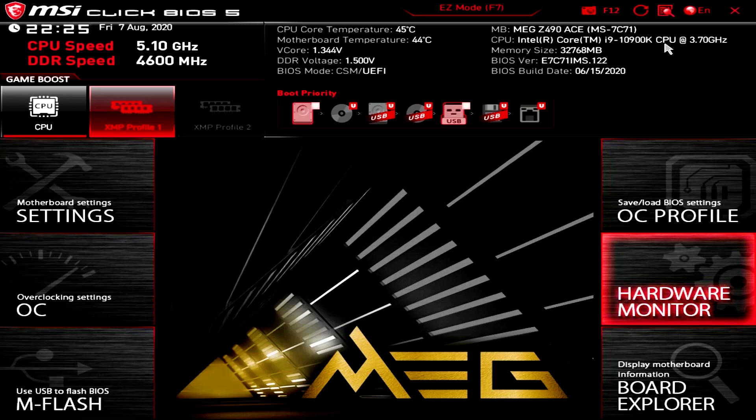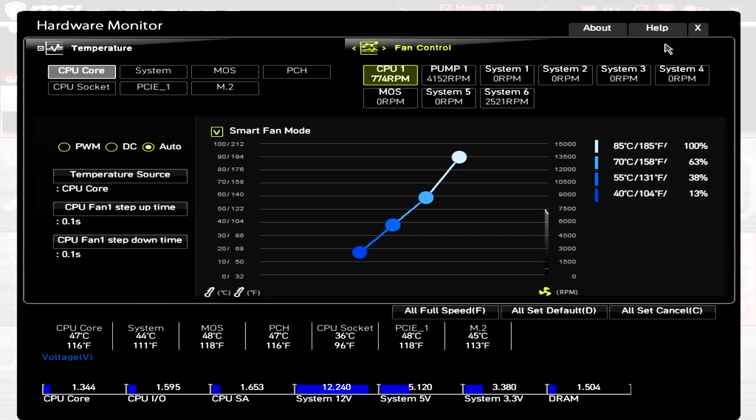Finally, some cooling tips. If you're hitting around 90 degrees, you should lower the core voltage and/or core frequency. The CoreLiquid 360R monitors fan speed and you can choose the performance fan profile, which runs fans at max — useful while stress testing to dump heat as fast as possible. Also visit the hardware monitor section in the BIOS, where you can adjust fans by configuring the smart fan profile for heavy CPU loads like rendering.